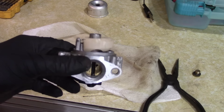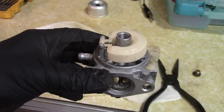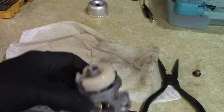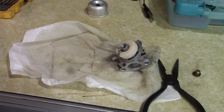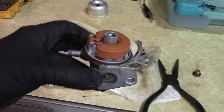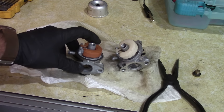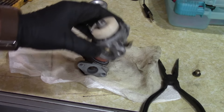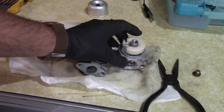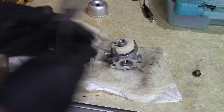What I want you guys to take a look at is — the float is higher on this side than it is back here, so we really need that to be level. I could go ahead and bend this plastic, but I don't really want to do that because I don't want this guy bringing it back — he's in a bit of a pinch and needs to get his yard cut. Here's another Briggs carb and you can see this one's perfectly level. This has darker plastic but I'm pretty sure the floats are the same size. Maybe they used a different material back in the day — this one has an auto choke. Let's just switch these up quick.